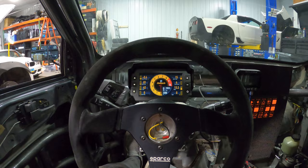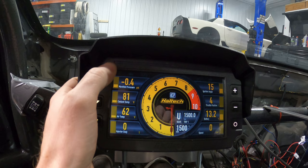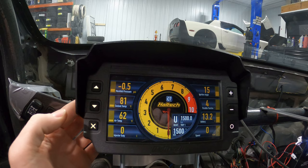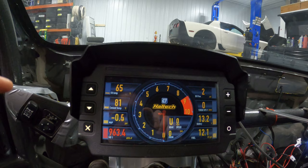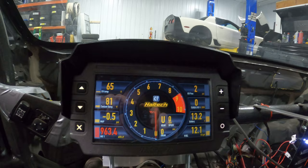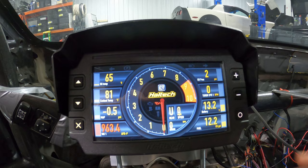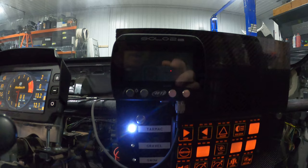For a dash we're running the Haltech IC7 dash — a seven-inch screen that fits perfectly behind the wheel. There are a bunch of different configurations: multiple pages, you can change colors, change every gauge, and set up warning lights for everything. You just need to set your max and mins. The second page shows oil temp, coolant temp, and other parameters. You can also set your tach however you want — redline at 8,000 or max at 9 or 10. It also has dimming, with buttons on the left side easy to find even with racing gloves.